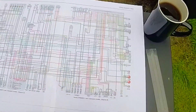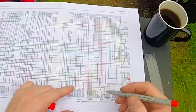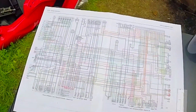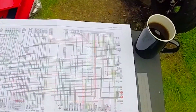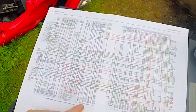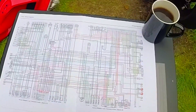The first thing we need to find is our regulator and rectifier, which is just here. There's our alternator. And there's our battery. And the wire we want is this wire here, which is the black and white wire. The other thing we need to find is ground, which is here. Ground here, which is on the negative. That's the oil pressure switch, that's the neutral switch, that's the engine coolant, which are negatives anyway, and they're already attached inside the engine bay. There are no other negatives at all.